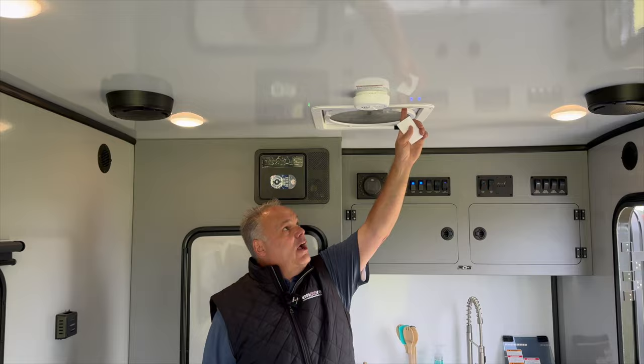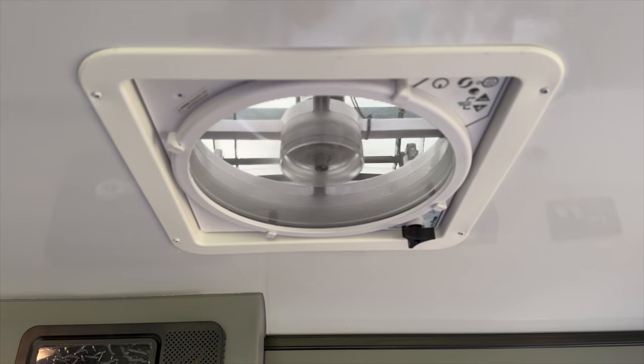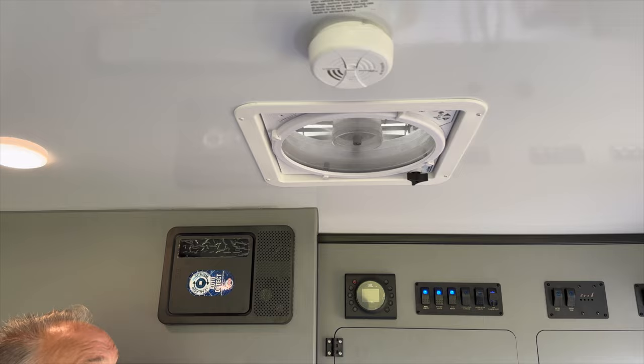If you find yourself off-grid with no 120-volt power and you're wondering how you're going to move air around, there's plenty of ways. You've got the optional rear pull-down screen, your two side windows with screens, your tip outs have screens in them, and your side doors can have screens in them. You can shut down what you want, open what you want, and pull or push the air out with your MaxAir fan. This is the deluxe version with the wind cover on it, so the shield on the outside can actually operate while there's rain and no water will come in. The tip-out windows will allow you to pull a nice breeze in. It'll even hold a business card up there — it's pulling so much air — and you can conveniently use it from your bed with the hands-free remote that's included.